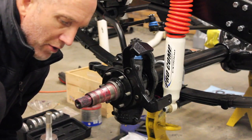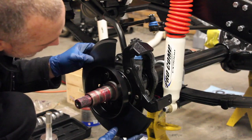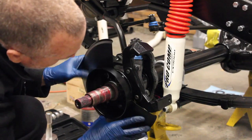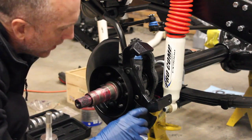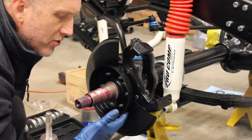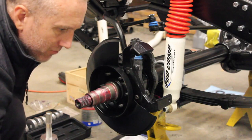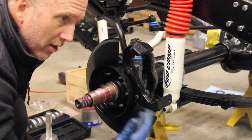When you install the dust shield, you want the cupped area facing the outside, and install it lining up with your caliper support. It's really super tight on mine. Maybe these came off an 84, and they may have changed the brake shield's orientation a little bit relative to the caliper engagement. Note to self: if you're using dust shields from a different year model, you might have an alignment issue.